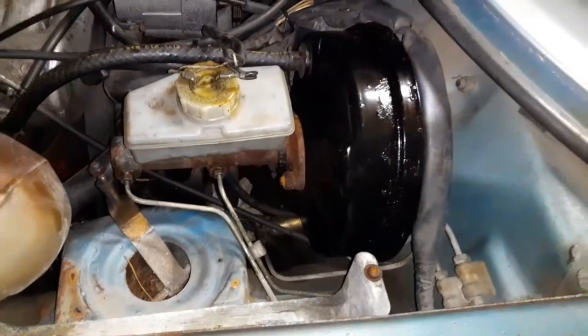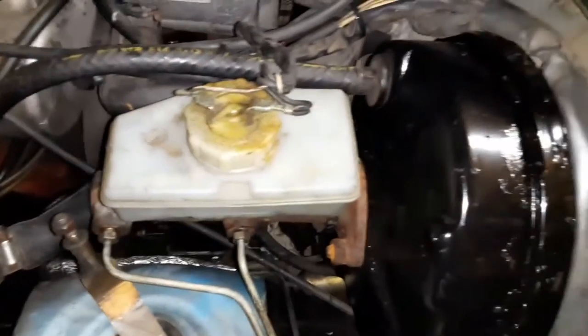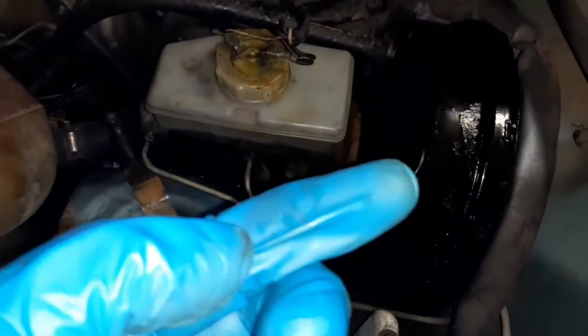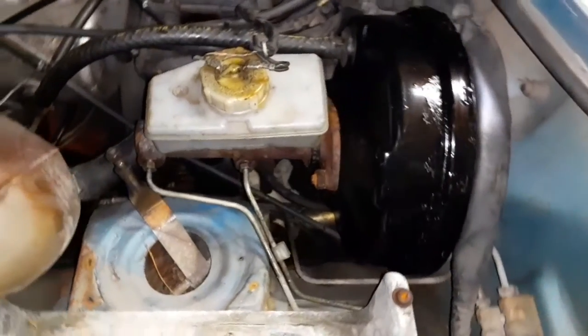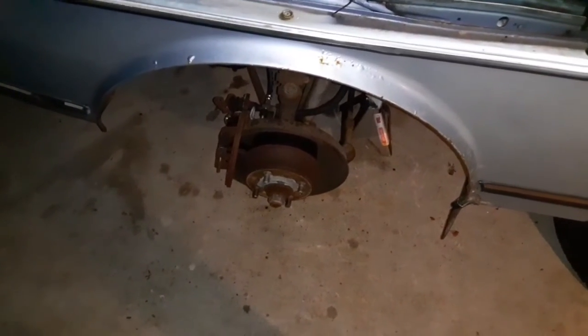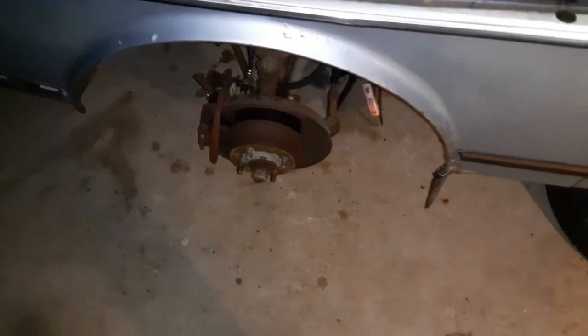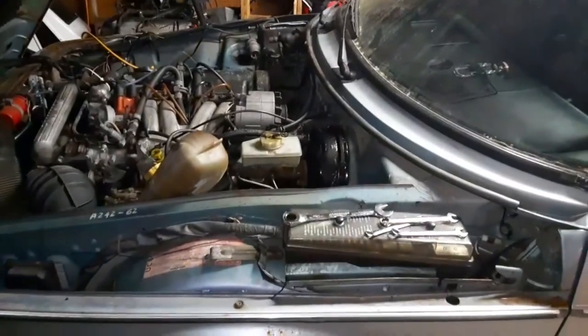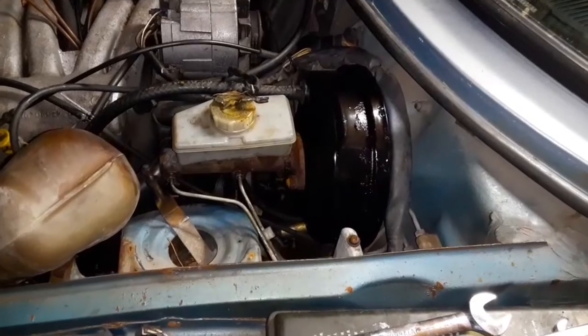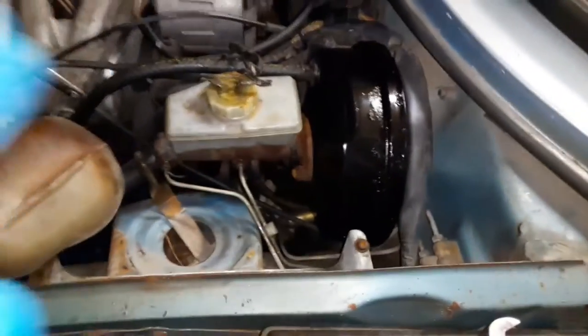The master cylinder is in place and the connections are made. I filled it up and so far there are no leaks — it looks dry. I ran some fluid through it with a vacuum bleeder and it pulls fluid pretty well. In fact, I used so much fluid I pretty much ran out, so I could not do the other caliper — I started on the passenger side. I know you are supposed to bleed the rears first, but they are a separate circuit so it should not matter. I am going to let it sit overnight and check for leaks in the morning.